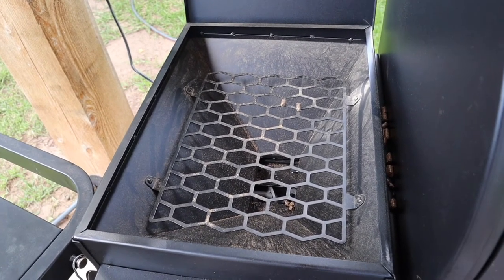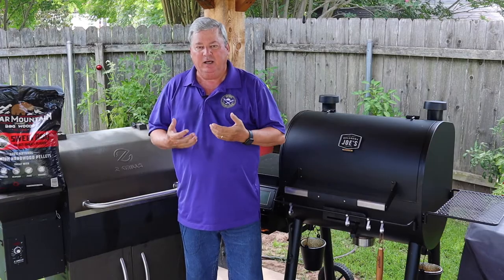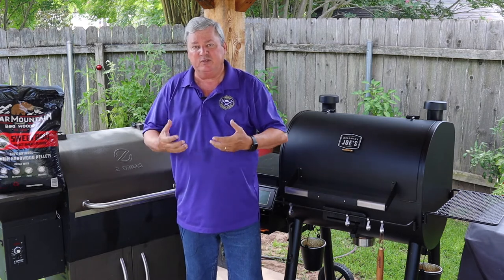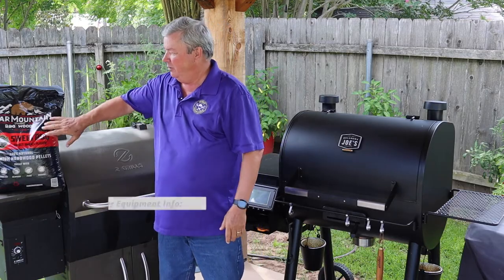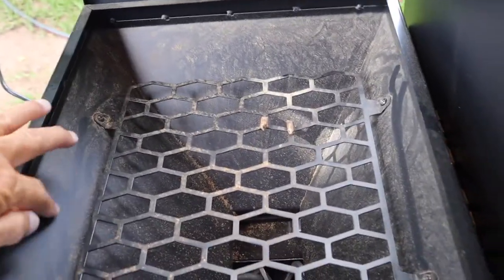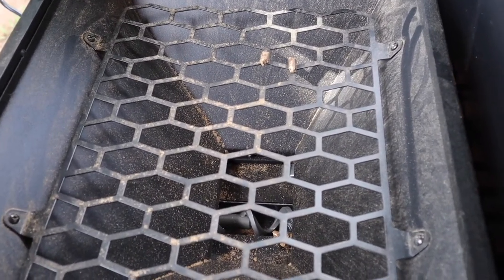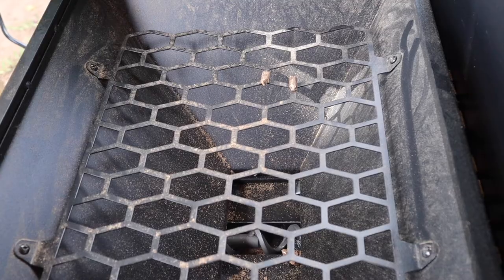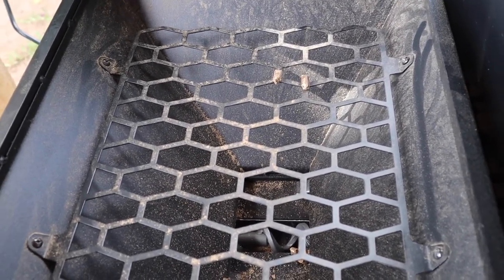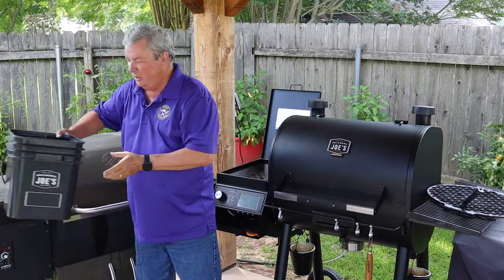Sometimes in the middle of the night it'll stop heating. Going one step further on our hopper is what quality of pellets are we using. The biggest difference in quality pellets is not only the amount of smoke but also the amount of pellet dust you get. I prefer the Bear Mountain brand. When we look inside our hopper you can see all this dust — this is not that much, but if we have too much pellet dust it can clog up our auger as well as prevent our combustion chamber from firing up.